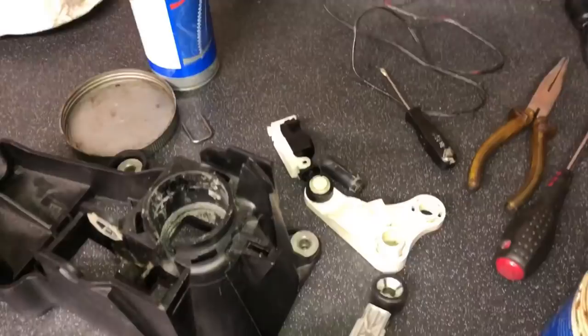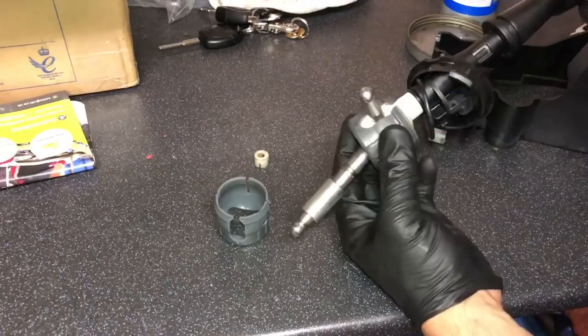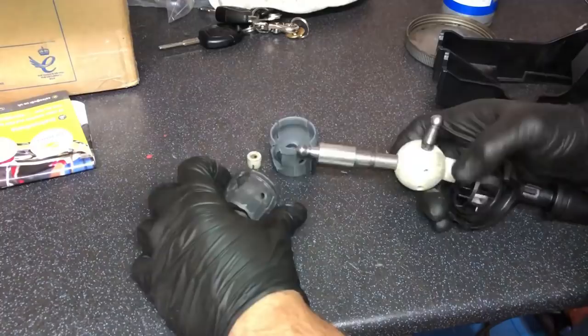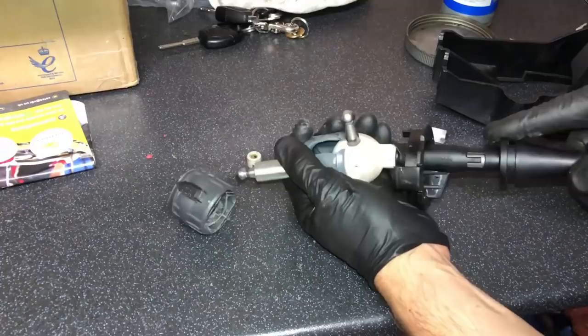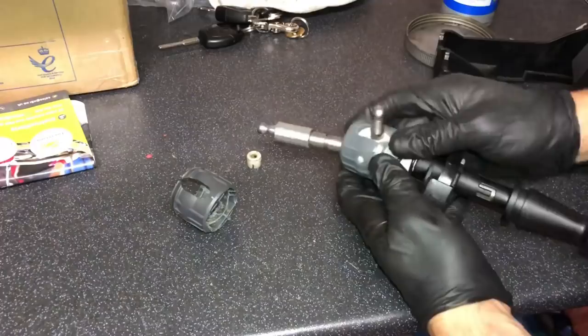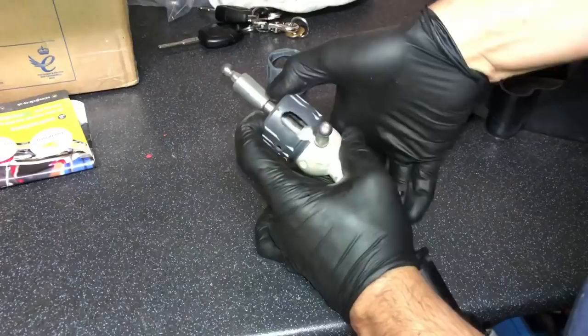I've started to clean up the ball joints on the pins — they're going to have nice fresh grease on them. Here's the old bush still on the ball joint; you can see the excess play and the movement in it — it's not tight at all. I'm going to show you: it pushes off like that, and this is the new one that just slots straight back over. I'm going to grease this up — just dry for the video — and you can hear how it clicks in. Look, no movement at all now, absolutely solid. That's going to feel lovely.